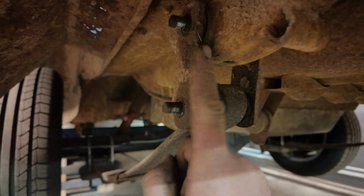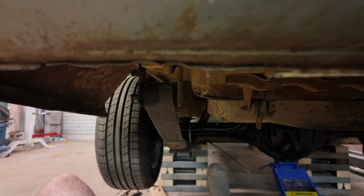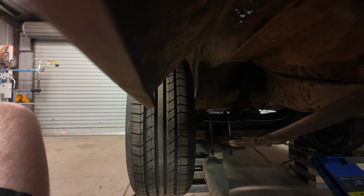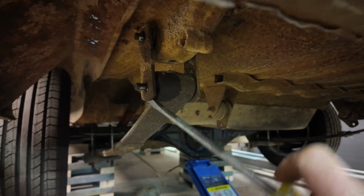So go and get your biggest pry bar or flathead screwdriver. And what the goal is here is to use that to lever the shackles off one side. You need to get the flat plate off. And when I say the flat plate, it's normally the side the nut comes off. So this one removes, and the 2 pins are actually welded. They're part of that shackle. So this is the hard part, is you've got to actually pump it up. It's about there somewhere. There actually is a point, hopefully, like that. See how that just came off nice and freely.